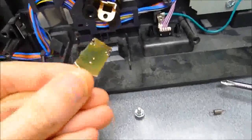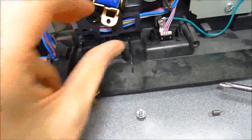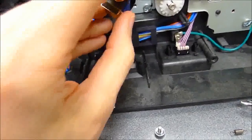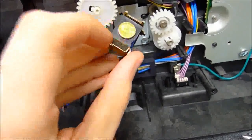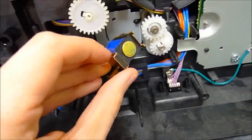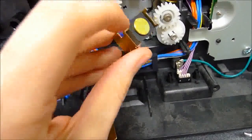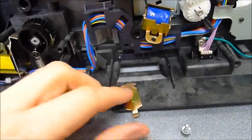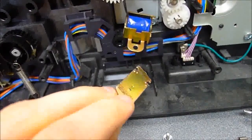Turning this into the light, you can already see there's all kinds of black gunk caked on the top and bottom — that's the remainder of the bumper. There's a bumper right there, and there might have been a little bit of one at the top as well. We need to get all of that stuff rubbed completely off. You can replace it with something — maybe wrap some string or some sort of non-adhesive method — but for a printer this old, I'm just going to leave it completely uncovered. It might make a little more noise, but at least we can be assured this problem won't happen in the future. So we go find some rubbing alcohol and a tissue and get to work on it.